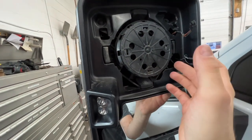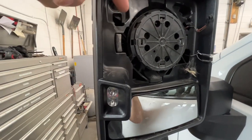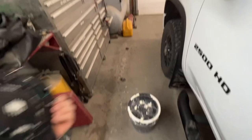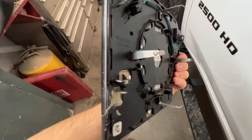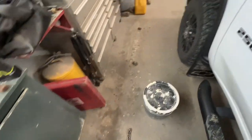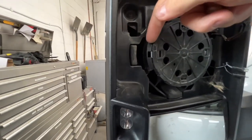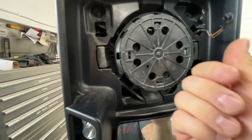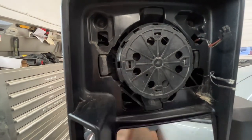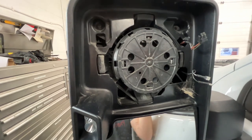Wiggle the glass left and right, and once you get enough room down the sides, take that same hook and find the tab — it's in behind. You'll know where the tab is because you'll see this silver bit right here; the tab is just behind it. The tabs on the outsides — you want to pop them outwards from the center, so this one goes toward the truck and this side goes out away from the truck. Get those four off and the other two will automatically unhook; you can tip it and unhook it easily.